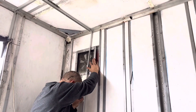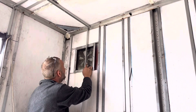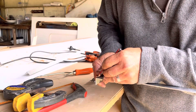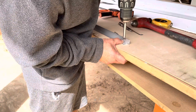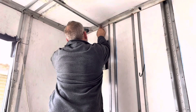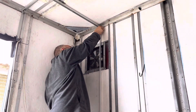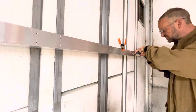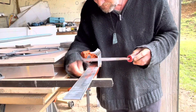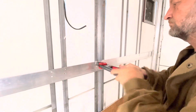We already had this piece of aluminium channel cut. We hadn't put it in place because we have to remove the vents before we can put it in. Once in position we realised this piece of channel needed a slight trim to make it fit properly. Now it's ready for drilling the bottom hole. We also realised that the rivet gun won't fit, so we have to remove the rivet holding the top piece. We decided to move on to installing the bunk sections for the two boys. This piece just needed some minor trimming before it would fit in place. Now it's ready to be riveted into position.